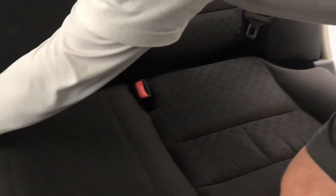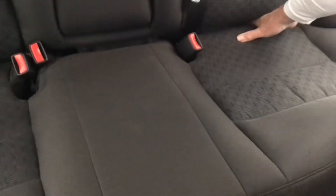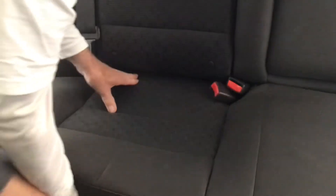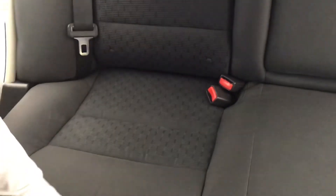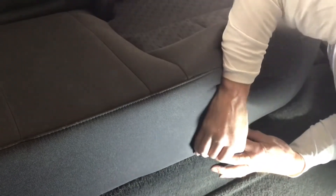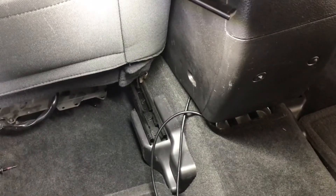Once you get the cushion in the general area, locate the seat belts and get them into the slots — make sure they're not twisted into a reverse position. You can always check by attaching the seat belt. When everything is lined up push the seat back as far as you can and push the cushion down to engage the u-shaped bracket. On the front of the seat at the bottom locate the two hold down clips, pull the black lever forward — this will allow you to push the u-shaped metal bracket on the seat into the plastic hold down clip.